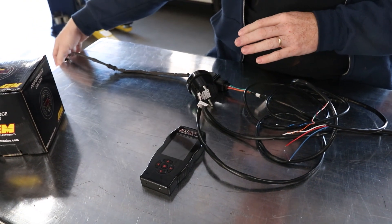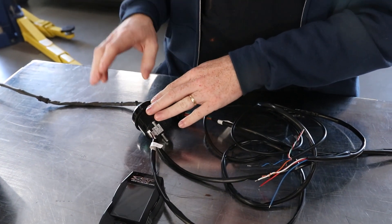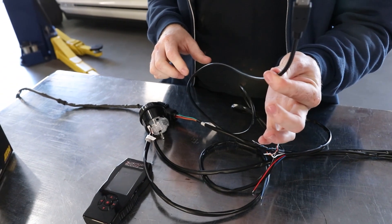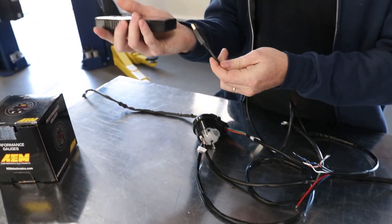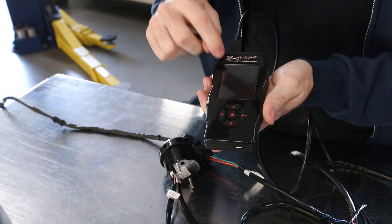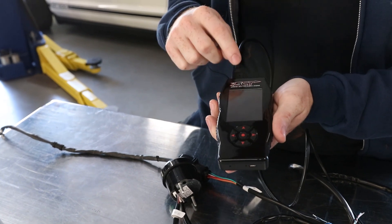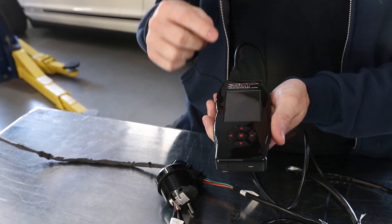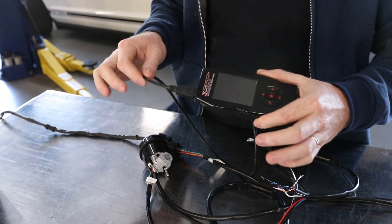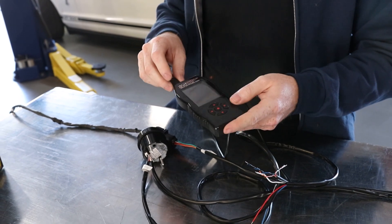What this does is take the air-fuel ratio from the sensor, run it into the gauge, and the gauge converts that to a zero-to-five volt output. That zero-to-five volt signal goes through this cable and plugs into your SCT. That allows us here at VMP to see what the air-fuel ratio is doing at driving and wide-open throttle without you having to relay that information manually. We'll be able to see it right on the data log. Now let's jump over to the laptop and I'll show you how to set up the software to record the air-fuel ratio.